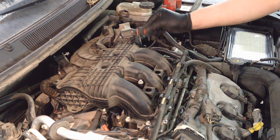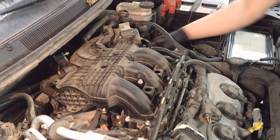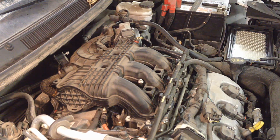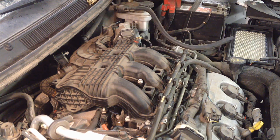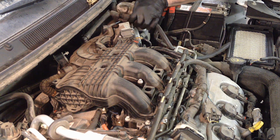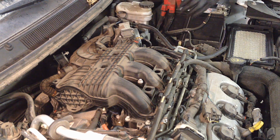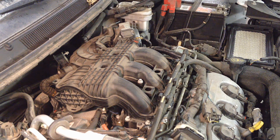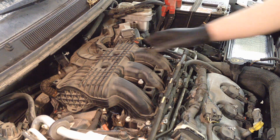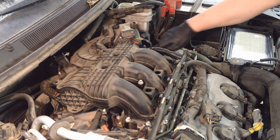Connect the electronic throttle body back up until it snaps — push and retain it. Before we go any further, make sure we get this quick connect in for the booster. So we don't put the brace back on first — tighten that connection, then put the brace on, and we can put the snorkel back on. At this point I want to torque the intake down, then we can tighten the two support bolts.